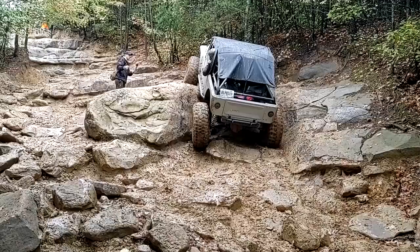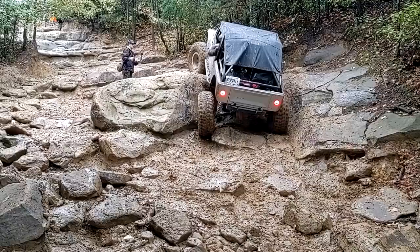A lot of people run RV antifreeze if they're running their tires in the winter, but the reality is where I live, my tires don't really do that well in the cold and snow anyway, so I change them out with others. And that's kind of the case with most sticky compound tires. But the tires I run, I'm going to use water, and I'm only going to fill it up to half the hub. A lot of guys will run their fluid to the top of the rim. I run mine half full. The reason for that is when you get out on the East Coast, sometimes you have to have a lot more tire spin. And with that tire spin, when your tire is completely full of water, you kind of brick wall into that rock as opposed to bouncing over it.